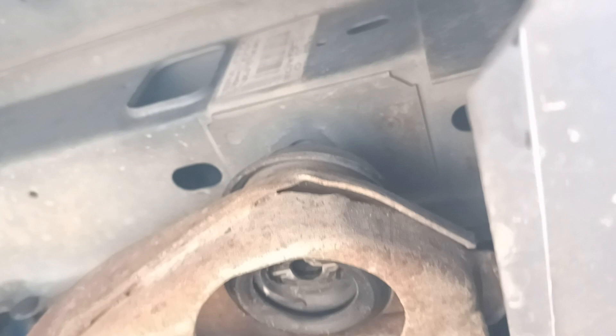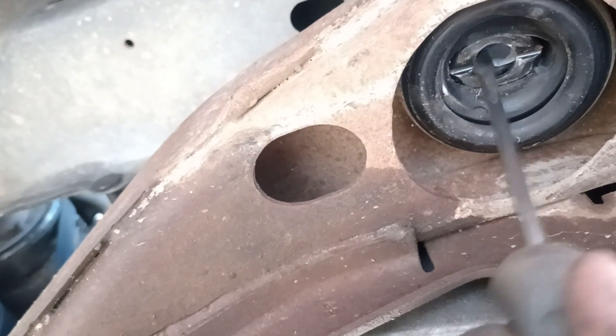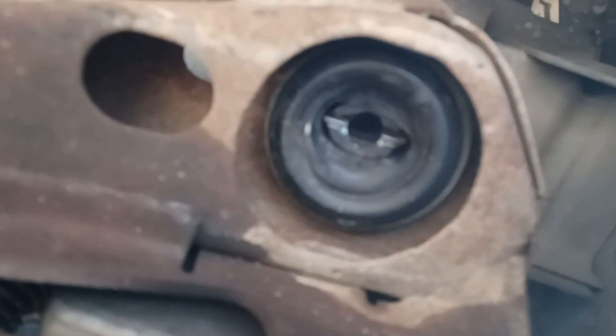What you'll need to do is take your jack and loosen it just a little bit — see it coming down. I'm going to tighten it up, make sure I've got about an inch of clearance. You might need a little bit more. You're going to need a flathead screwdriver or something to get up in here and press — you'll have to press this metal piece out the top. I'll take the screwdriver on top of the washer and just pull down on it, and you can see that thing just scoot right up in there. You just work it back and forth to get it out.